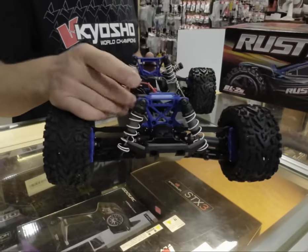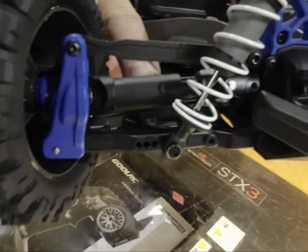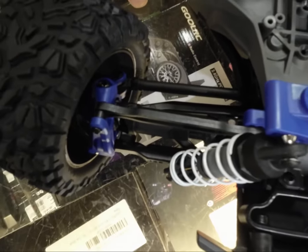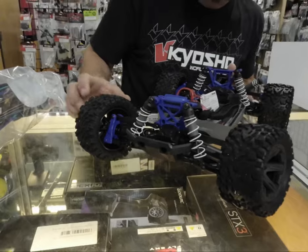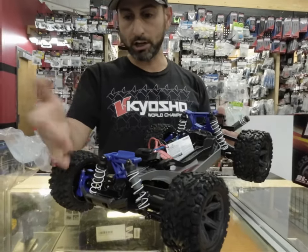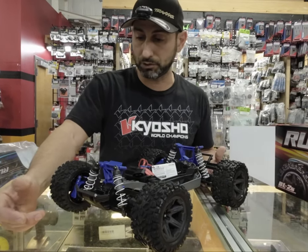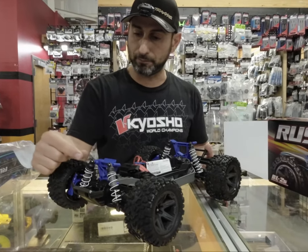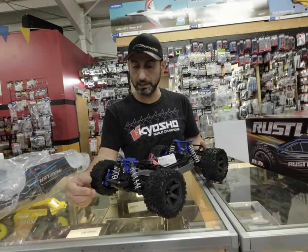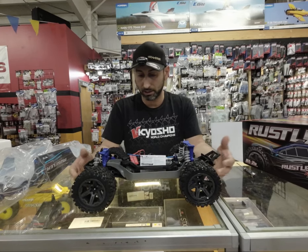I really like the blue parts — they might be a little stronger than the black plastic. Pay attention to the size of these drive shafts: they are much thicker than the regular 4x4 VXL, which is very impressive. The joints are much bigger and the plastic is thicker. As for the shocks, the only thing is Traxxas still only gives you shocks that are not adjustable — you can only adjust them with little plastic spacers, c-clip type — but they've been proven to run and handle good.